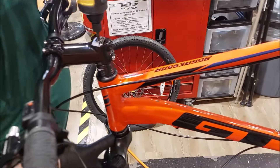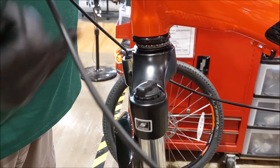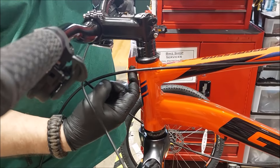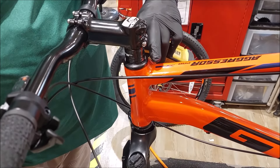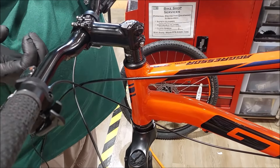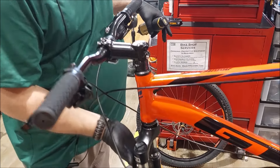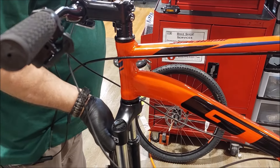Here at the bottom there's what's called a race face, and inside there's a set of bearings. The cap on the other side is the other race face. Those two race faces allow the bearings to spin. There's a hollow rod coming all the way up through here — two crown sets that let me screw the cap on. I've got bearings on the top and bearings on the bottom. I want to compress it just enough so they spin but aren't falling apart. Right now it's all kinds of loose, so I'll snug it up carefully so I'm not crushing the bearing cages.